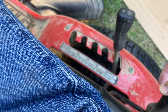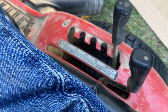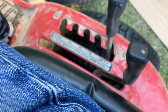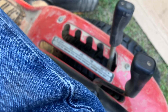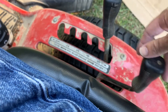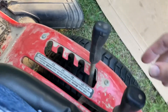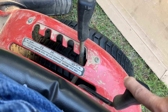You can do what you need to do — if you just want to ride around, drive it out of the shop or garage. But a problem comes when you want to go in reverse, because the blade has to be disengaged when you're going in reverse. This doesn't look like it's going to be making any switches on its own, so you'll have to put it in reverse and hold back on the handle the whole time so it thinks the blade's disengaged.